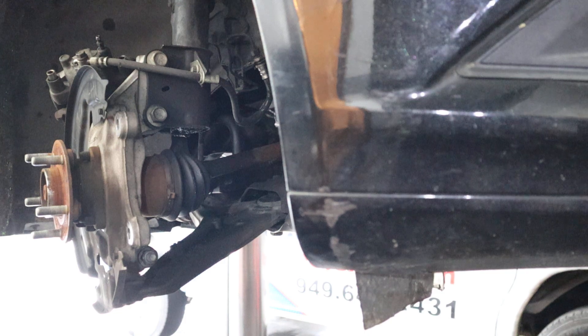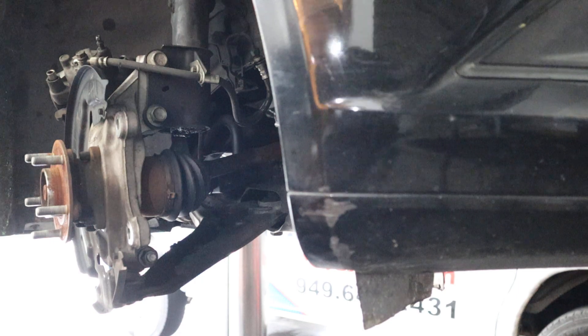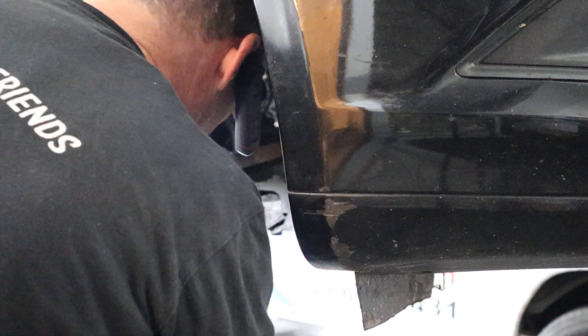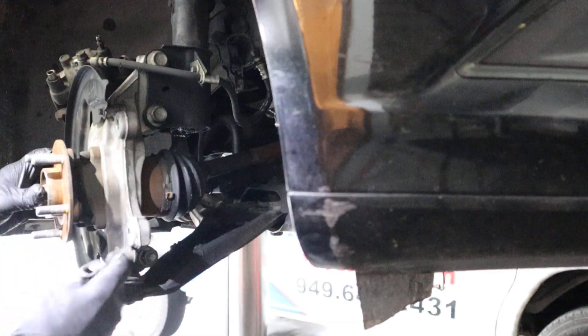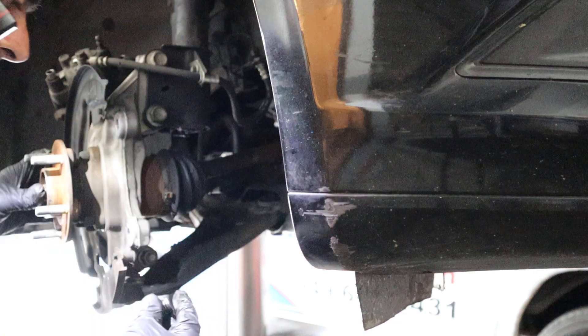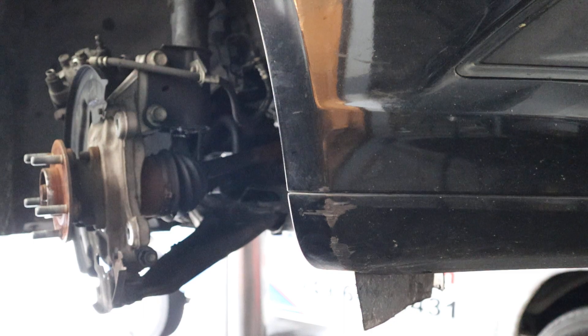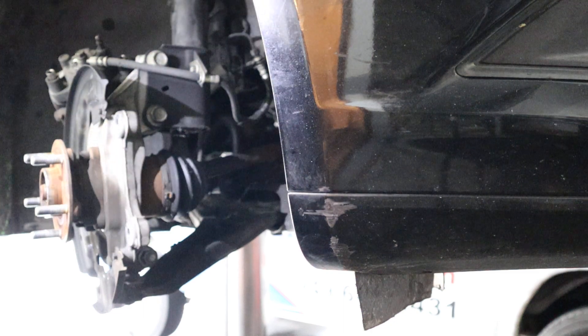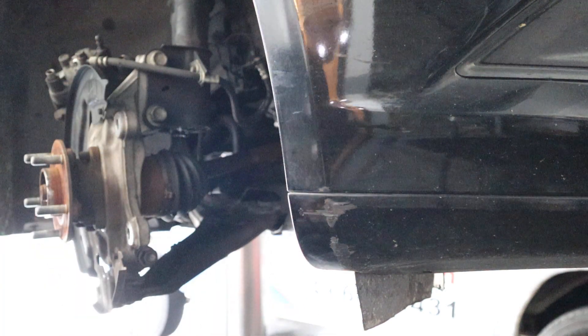If you're at home without power tools to take the axle nut off, put a breaker bar on the ground and put the car in drive. The back bolts feel like 14 or 15s. See how this guy moves back and forth — and we are, in fact, 15s. We are a little bit tight for access, and it wouldn't hurt to have the tie rod disconnected.